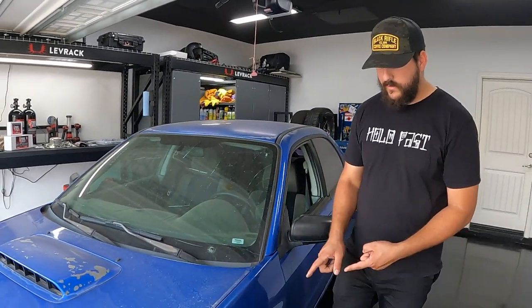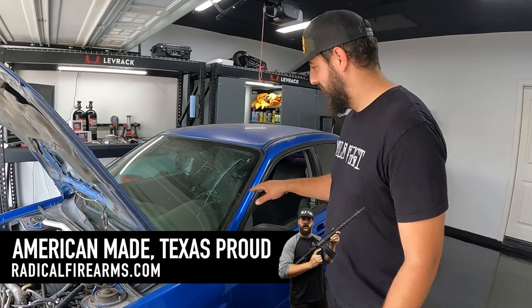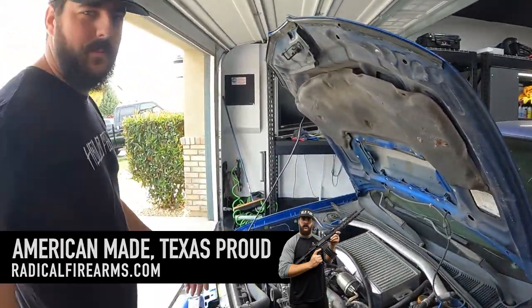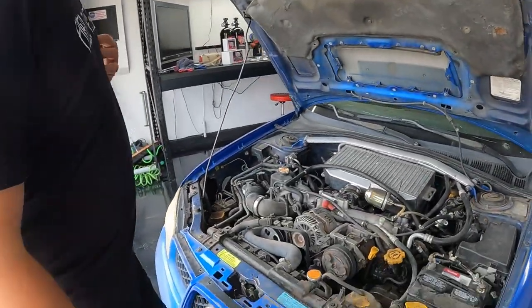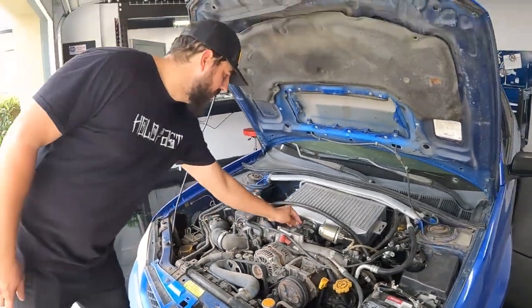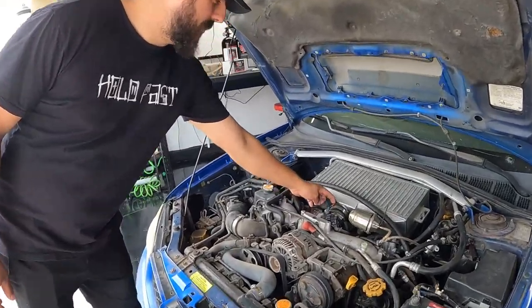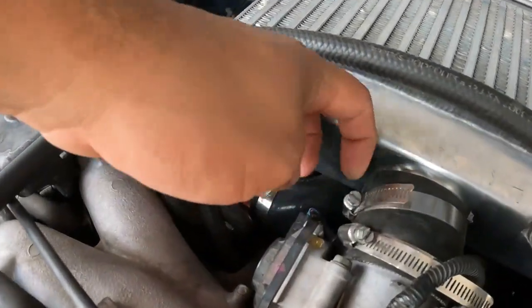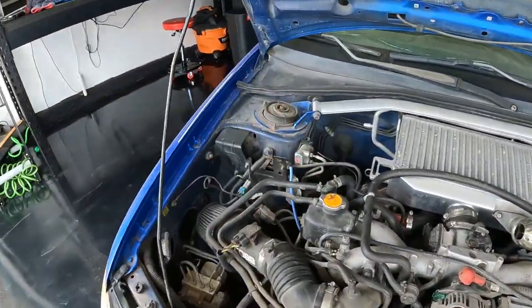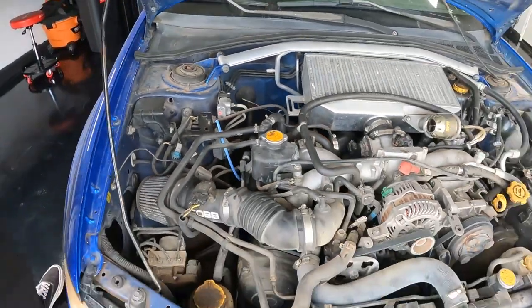We're going to be doing suspension, which this has. Well, let me just show you around the car first. The car is disgusting, okay? It obviously needs a windshield. It needed a windshield way before I hit it. It's spider cracked everywhere. I shouldn't say disgusting, it makes me sound like a prima donna. The engine bay needs a lot of love. Here is a clamp that is off and there is a big boost leak right there. The wastegate is wired shut, which you guys saw us do when we messed around at Frankie's house.